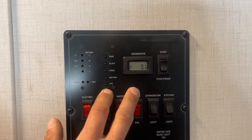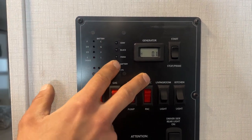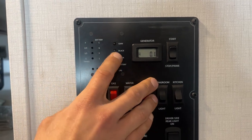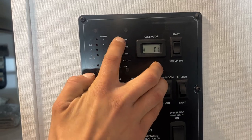Monitor systems in the top left here. LPG is going to be liquid propane gas — as you press that, you can see you're currently full. Battery: currently C for charging, G would be good, F is fair, L is low. Fresh tank, as you fill that up, will go to a third, two-thirds, then full — same idea for your black and your gray tanks.